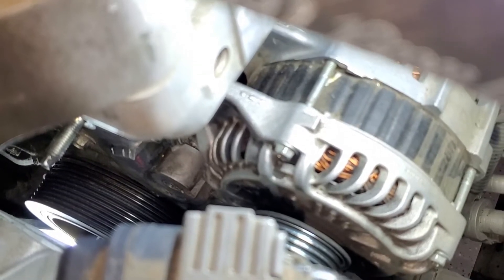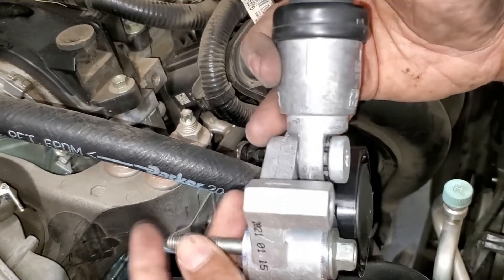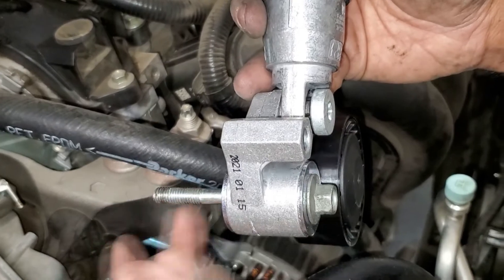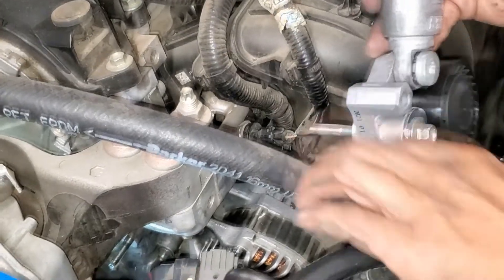So that when the belts seat there is no slippage. We're now going to install the new belt tensioner. I've already slid in the bolt because we won't be able to install it afterward, so we're going to install it through here.